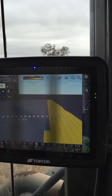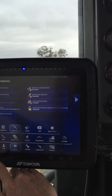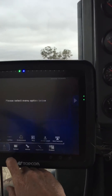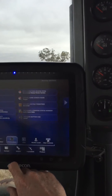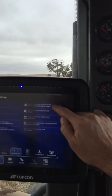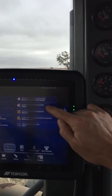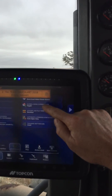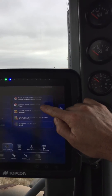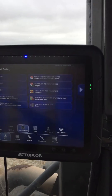So yeah, it's a pretty handy feature. To enable it, you just go into the set up menu, and you go to User, then Environment, and you set the multifunction region mode to Save, Load, Global Home Screen. And you can set the screen mode to just toggle between them, or pop up that window every time you press it and it'll let you select them.